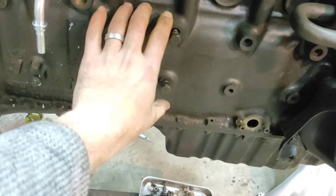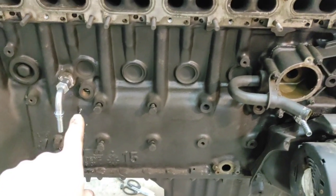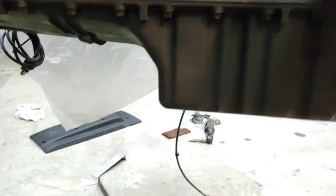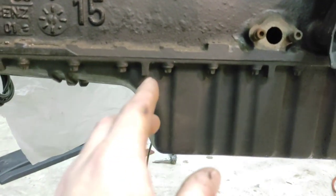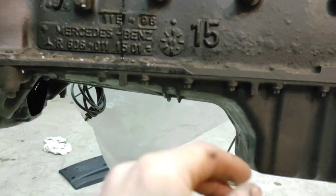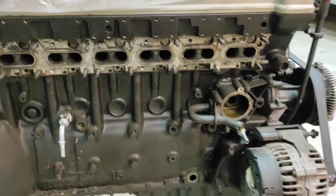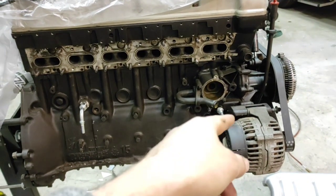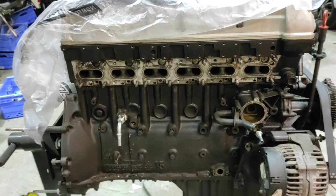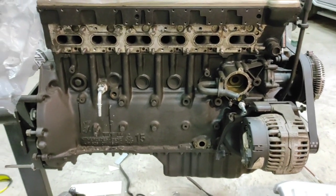Because the engine mount here, with the manifold above there, I'm keeping it away from the exhaust and turbo so the heat won't be an issue. And bringing it straight down here, there's a couple of these sump screws that actually hold P-clips for the likes of the transmission. So I might be able to even put some kind of P-clip on the hose to keep it down here. What I liked about that idea is the coolant will be coming out here, it'll be going low here, so gravity will pull any air locks back up to these two respective points. So there shouldn't be any air bubbles or issues with trapped air.